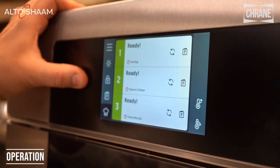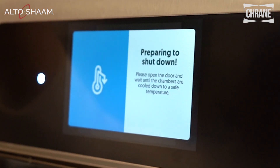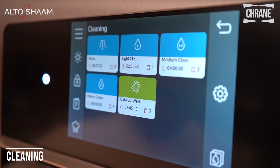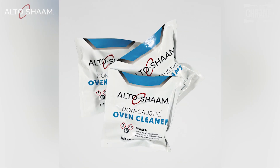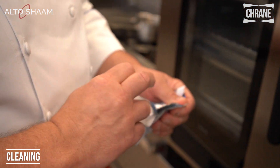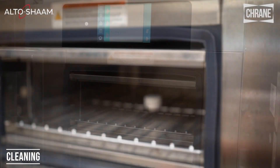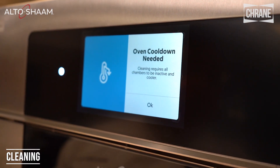When we're done with the unit, we'll simply turn it off. Press and hold the power button and you'll notice a shutdown prompt: please open the door and wait until the chambers are cold. We'll want to open the door so cold air can get in to cool down faster. Once it's cooled down it'll shut off and then you can close the door. For cleaning, we'll pick our cleaning cycle — say a light clean. Once the oven is cooled down, we add our non-caustic oven cleaner tablets, pulling the tab. Put the required number of tablets into each chamber, close the door, select light cleaning, and hit start to clean.